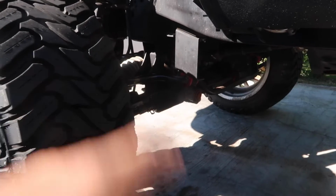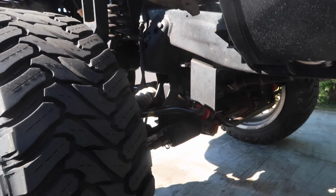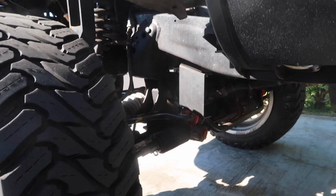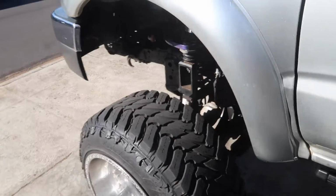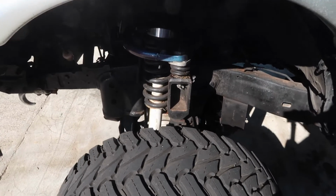And I didn't want to risk driving it while it has been leaking, because I'm not too sure if the fluid level inside the diff is low or getting low due to the leak, and possibly could end up messing up my gears or overheating the bearings, which happened before.